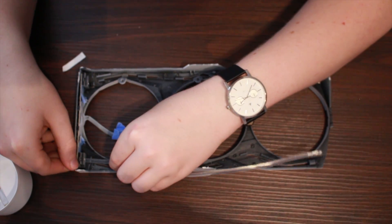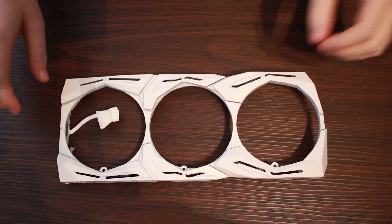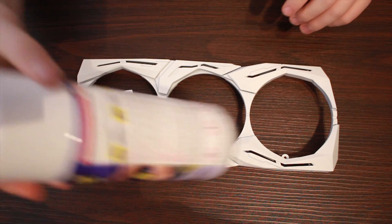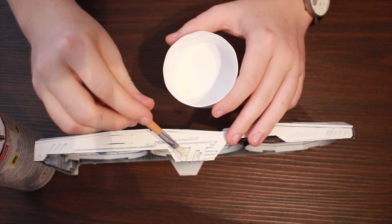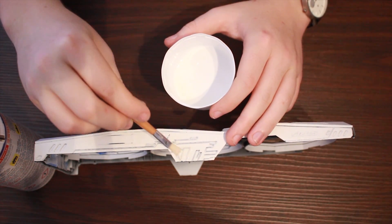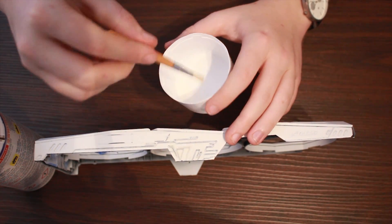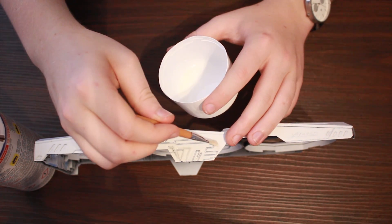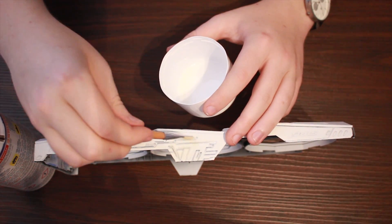Do this for all tape where it interferes with the finish. You can see here, the LED window has crumpled a bit — it's still sticky, so smoothing it out fixes it. You can see on the side of the card, there are still some black areas where the paint wasn't able to get to. It's quite hard to avoid this — it's due to Asus's weird alien markings design, making it difficult to paint, so this is where our mini brush comes in handy. Spray the Plasti Dip into the lid to use it as a sort of inkwell. Then dip the paintbrush in the paint and go over small details on your card. Be very light, because the wet paint makes the rest of the paint wet, so you can smudge your finish. I found the best technique was just a dab on the areas not touched by paint. Don't overapply here, because that will cause the side to look bulgy. If it still looks a bit black, it doesn't really matter, because you can't notice it when it's in the case — the shadows catch those grooves anyway, making it seem much more natural.